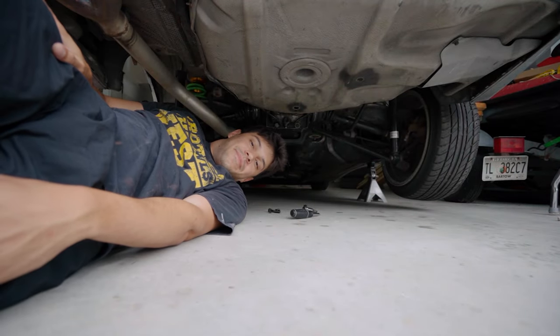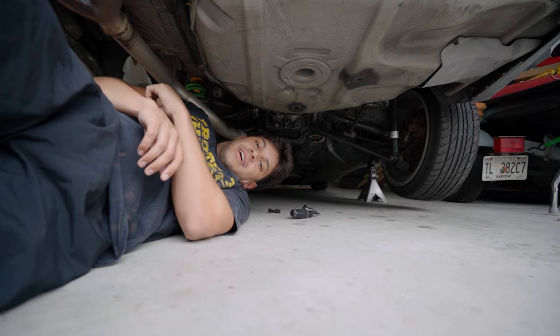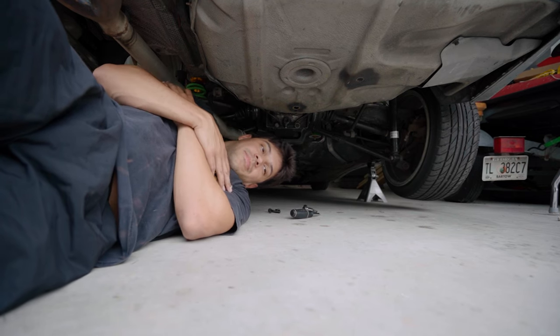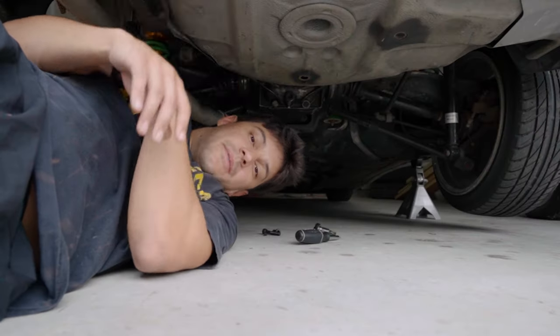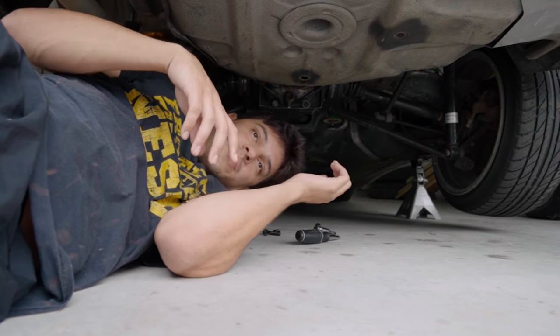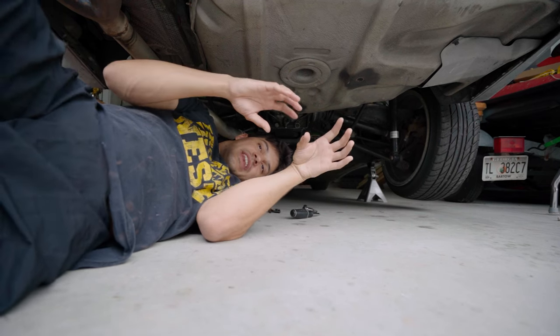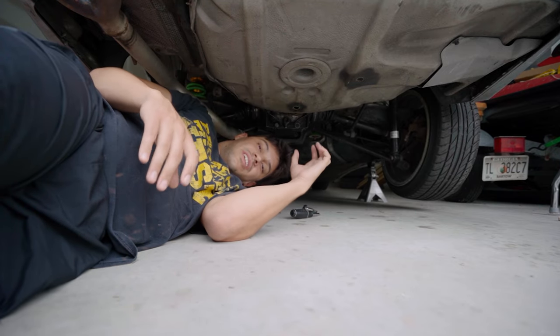So I was driving to work and my axle decided to come out of place. It was mainly my fault for not bolt checking it after drift events and stuff like that, but all the axle bolts backed out and ended up crushing one of the spacers, and it just made a really loud noise. And now my axle is leaking grease more than ever.